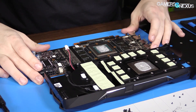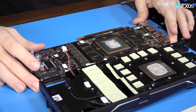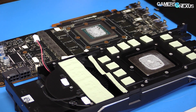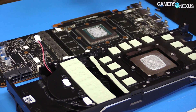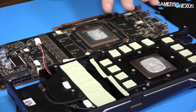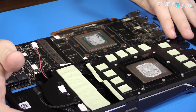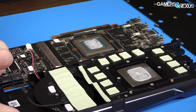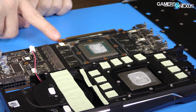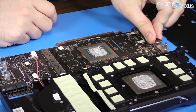This looks pretty similar to the 1080 Ti Founders Edition PCB and cooler. We have what looks like a nickel-plated copper cold plate making direct contact with the GPU — this is the biggest Pascal GPU available to consumers right now. Here are the VRAM contact pads — the thermal pads for the VRAM modules. This time, unlike the 1080 Ti, we actually have 12: 4, 8, 12. Normally one of these is missing on the 1080 Ti, but it's present here because we have 12 gigabytes of GDDR5X memory.